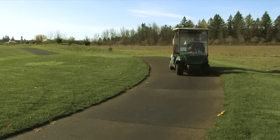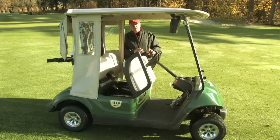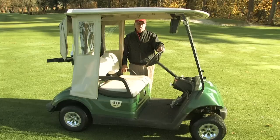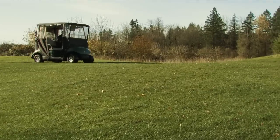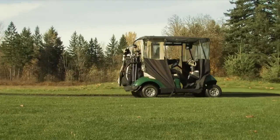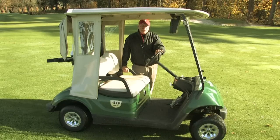It's very dangerous to take the governor off or to turn it off on a cart. With a cart you have full speed or coasting when you have the governor on. The governor actually works as a device for safety — when you start down a hill it starts pulling back and gearing the cart down so it doesn't go too fast and you get in trouble at the bottom.